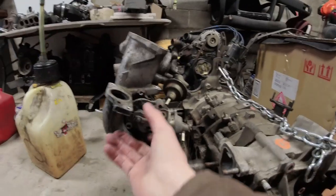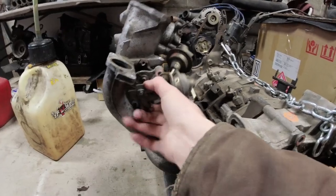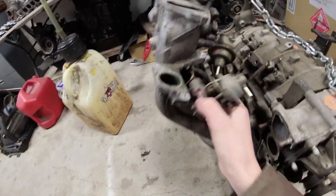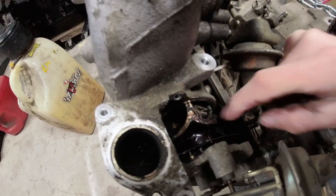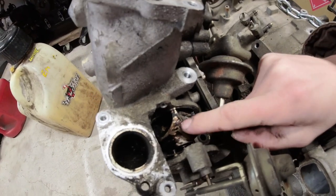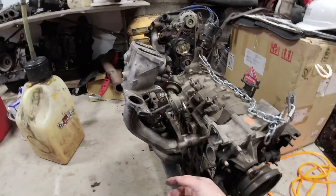The next valve is probably the most important one. This is called your SSV. This valve lives in here, and you can see I haven't cleaned this one. And look at all the stuff, the carbon, the crappy unburned fuel that is built up on this valve over time. Okay? See all that? It's supposed to be silver. It's supposed to be clean. That valve lives in here.